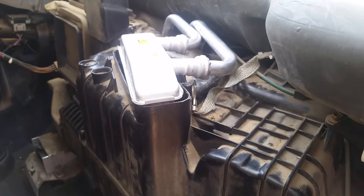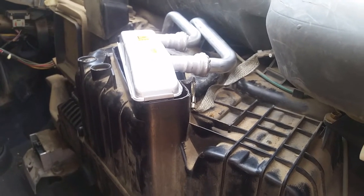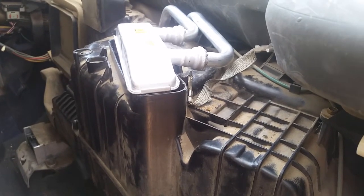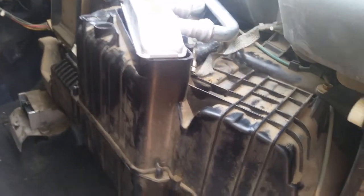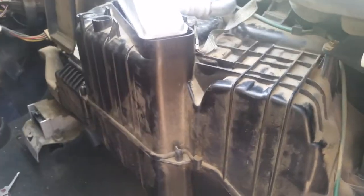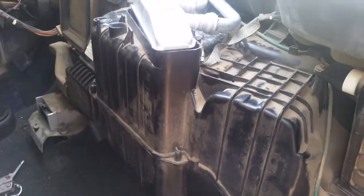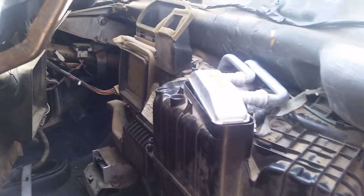What you do is turn your heater core to the side and put the tubes in first. It's going to take a little bit, but once you get the corner of your heater core started into this slot going down, just put some pressure on it — not too much, because this is only aluminum. You can get it in without removing the black box. Just a little pressure, that's all it takes.